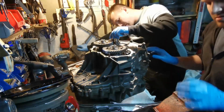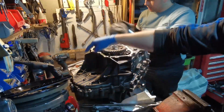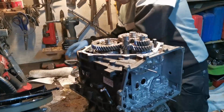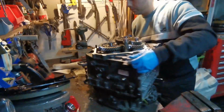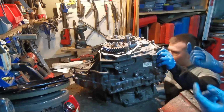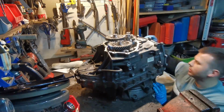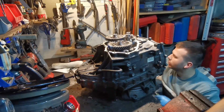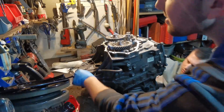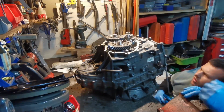It has a bit too much play. Right, let's get all these 20,000 bolts around the gearbox. Let's split it in half. Once you remove all the bolts around, make sure you flip the gearbox and remove the bolts that are inside next to the oil pump. There are a couple of pins holding it. You've got one locating pin here, one there. I think there are two on the diff. So that may take a little bit of battering.